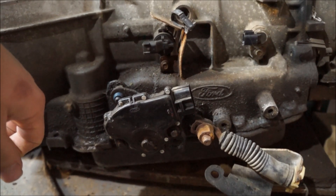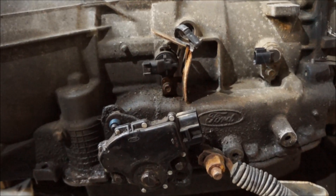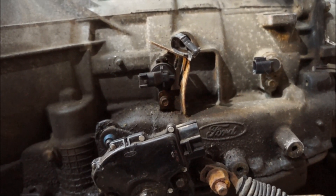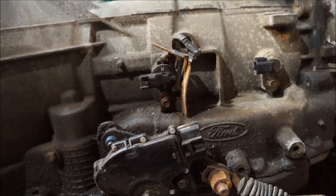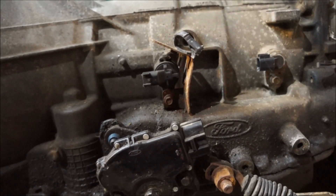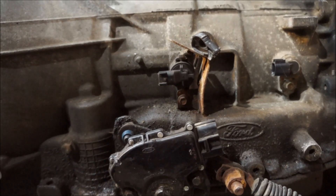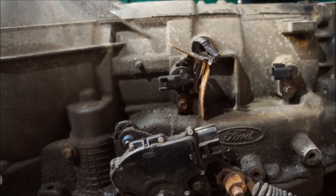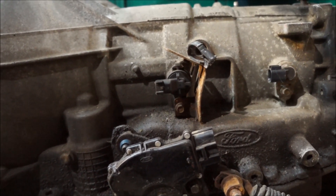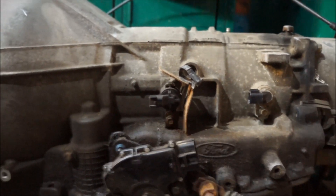There is a resistance in the module when it's left in neutral. The TSS turbine shaft sensor is only on the 2005 Plus Crown Vic, and the PCM still needs to see some input from that sensor. When there's no input, this is when it forces an engine shutdown. So we have to duplicate this signal using the crank sensor signal to fool the PCM into thinking the sensor still exists and is still sending data.